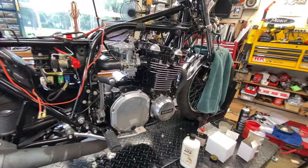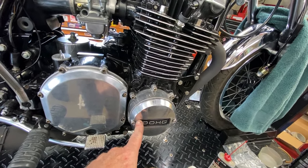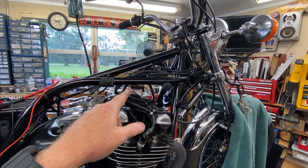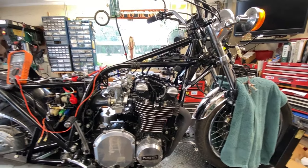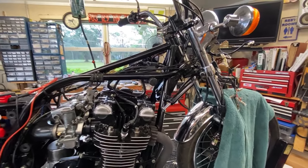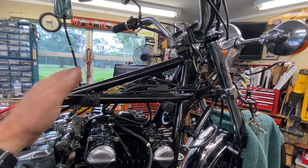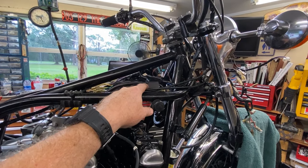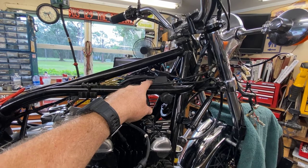Because of the way the points looked while sparking, I swapped the condenser pack over to the original one that was in the parts box. On the two-and-three cylinder side the sparking went down, but the one-and-four side didn't improve. Cylinder one is still giving a weak spark even with a replacement plug. I metered the coils up about a week ago and they're not exactly within spec for primary or secondary windings.